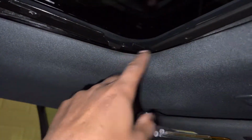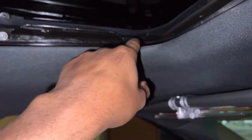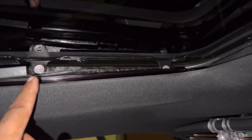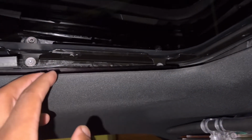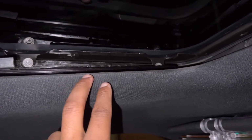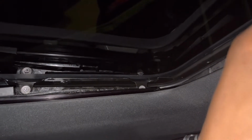That's the easiest way. You can do the front, tilt the front up, then tilt the back up. But you don't really want to tighten the screws on the front, because if you tighten the screws on the front and then try to lift the back up, you're binding the structure. Because this is tight, and then you loosen this and you're trying to force that up, you're twisting this up too. So it's easier to loosen this side, push it up, tighten it, and come to the other side, loosen that, push it up.